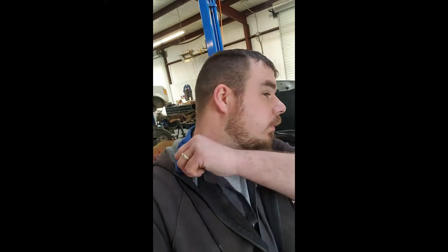So in the sake of saving some money we just ran it like it was. When I got home I started looking the car over trying to figure out why, because it was a Spec Stage 2 Plus and yeah, it was a little old but I don't think it should have been slipping at seven pounds of boost. Found out the clutch cable had failed and was holding the clutch pressed about halfway, which is what made it fail.